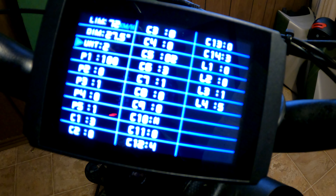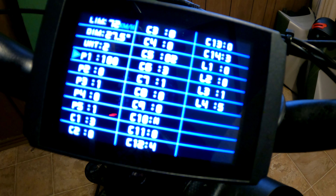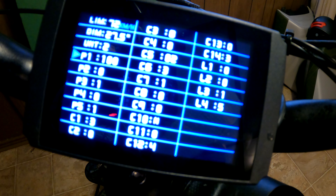Moving down to UNT, that is simply whether it is Imperial or Metric — one is Imperial, two is Metric, and three is a combination of both. P1 is your motor gear ratio to magnets. All Rad Rovers, from what I could find, are always set at 100, so I didn't need to touch that and left it as is.